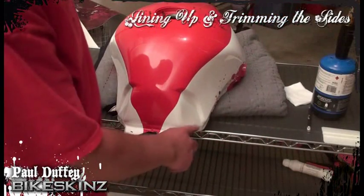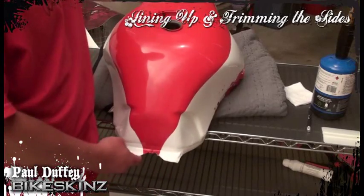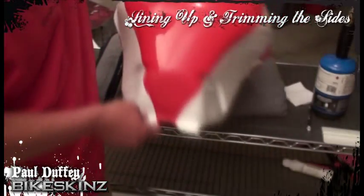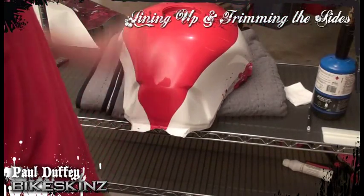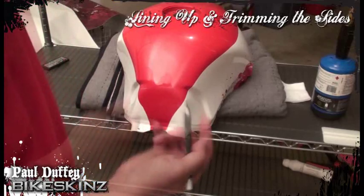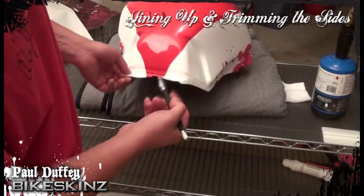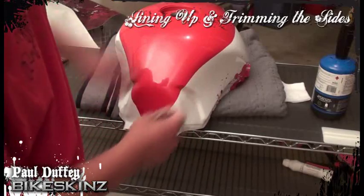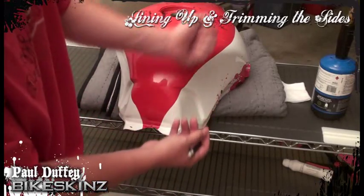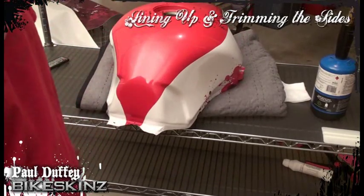At this point I've applied both sides. Before I put on the edge sealer, I'm going to do the top first. As you can see from the top of the tank, I've trimmed away the top area and made it even. When trimming, use the X-Acto knife — make sure it's really sharp. Once you cut away the vinyl, you're just barely going to score the top. It may seem like it's not cutting all the way through, but all you're doing is cutting away the laminate, which is the top layer. Then once you pull and peel it away, you'll find it's easy to cut through and get a nice clean edge without cutting into the paint.